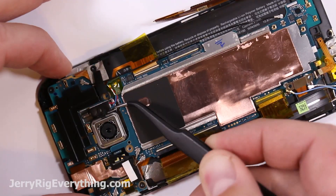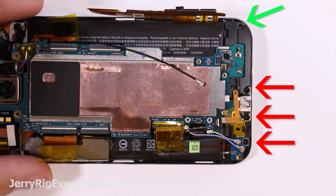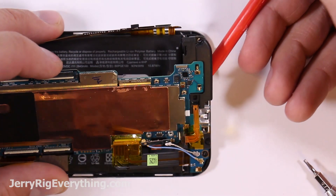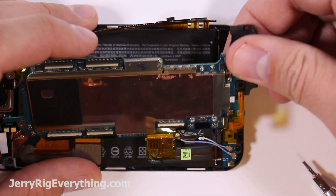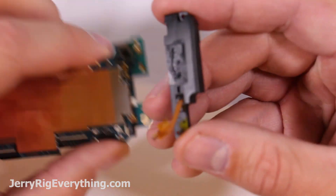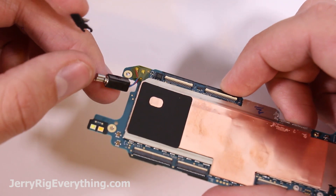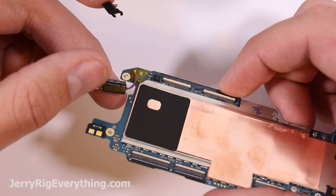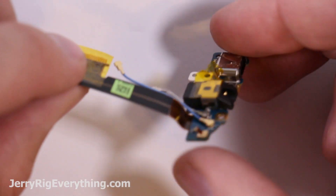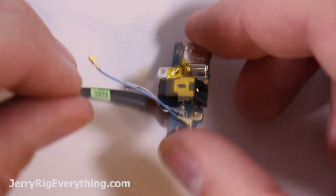And then there's the vibrator motor. It's interesting that every single thing has a connector on it except for the vibrator motor — there are four screws at the bottom, and the vibrator motor is just soldered onto the main board, which is silly. Now the motherboard comes out and it is connected to the bottom speaker just by some adhesive, so pop that out. Bottom speaker is here. Here's the charging port — charging ports are one of the first things that go out in phones. I'll link that down in the description below when it becomes available.